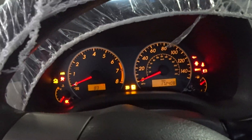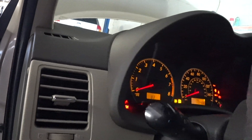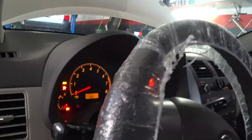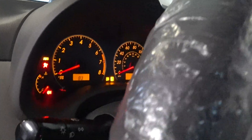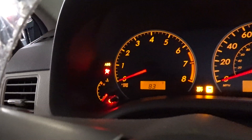The concern of the customer on this 2010 Toyota Corolla was that all the dash lights were on. You can see all the dash lights on with the engine running at idle. I do get a PCM light on, but I also have no speedometer — the cluster has just gone AWOL. We've got a cold engine reading even though the engine is hot.